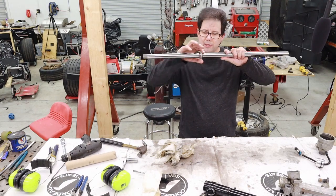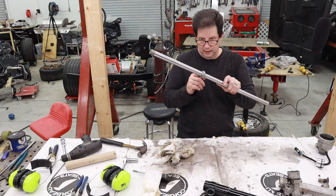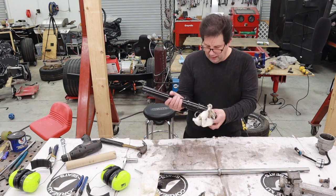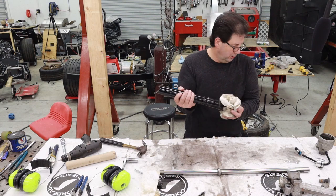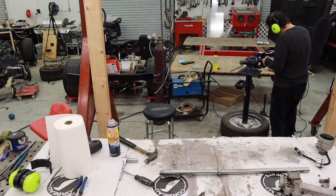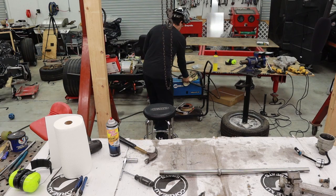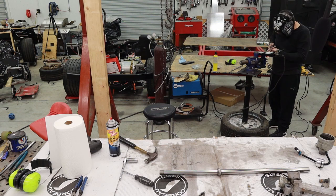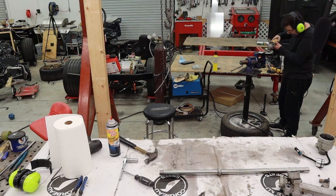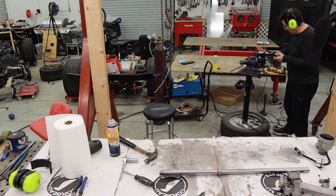The rack is kind of ground done. I basically ground it and got rid of the seal mechanism, then just hit it with the sander to get any burrs off. What I gotta do now is clean this up before I weld on it. I'm going to cut these off and then weld these holes closed.